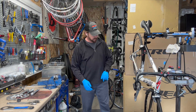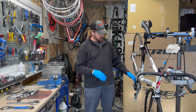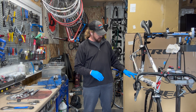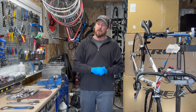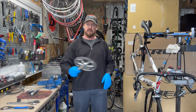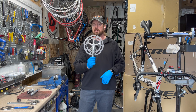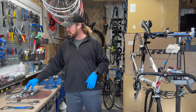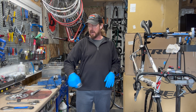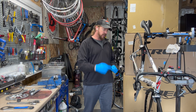Plus, wherever I had this bike before, I switched this to more of a compact, which is a 50 with a 34 or something like that. Luckily, I have some extra parts — the same length crank arm, the same vintage which matches this Ultegra, two chainring, 175s, with the bottom bracket. So you're going to watch me tear this off and throw on the new one.